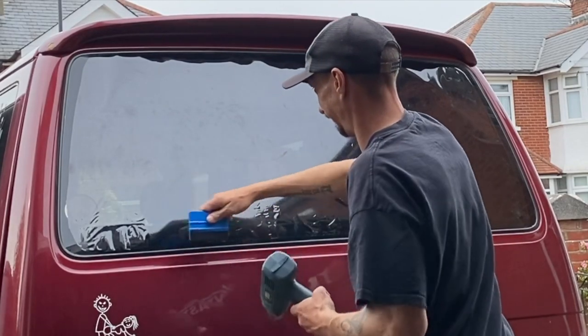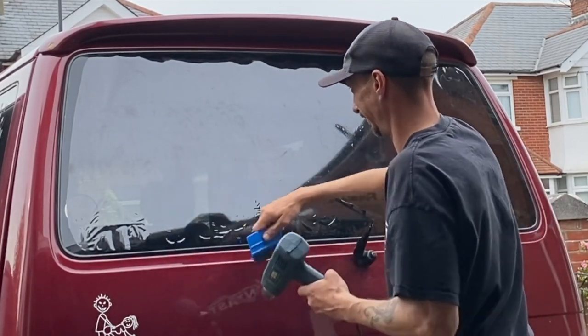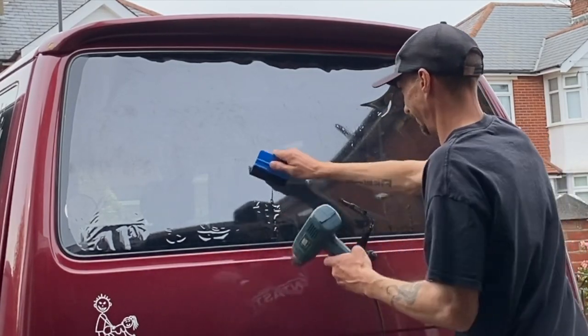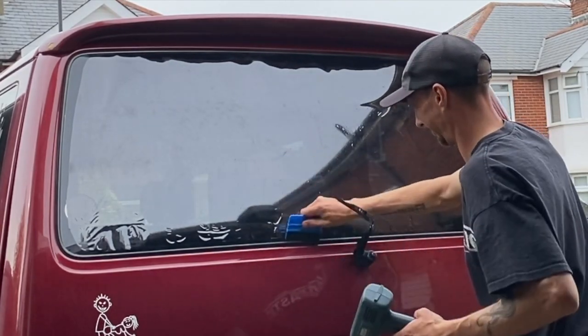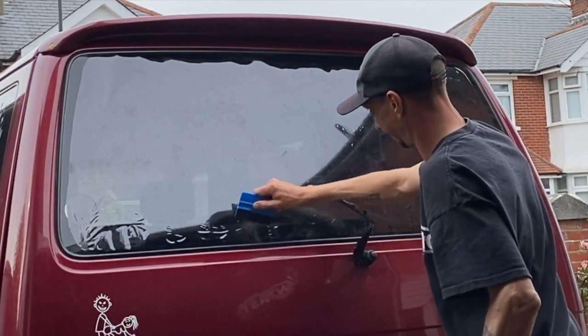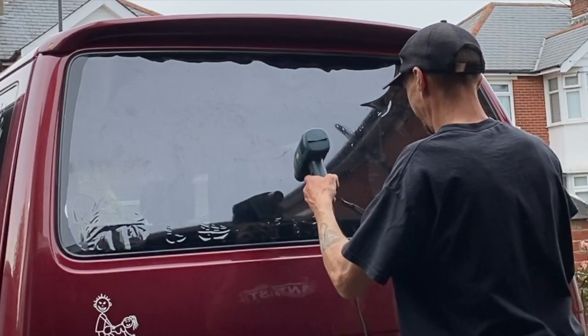And you can see here where the shrink lines are going sideways. That means that it's shrunk enough. That's plenty shrunk. So yeah, I wouldn't really worry too much when it goes sideways like that. You don't need to shrink it anymore. That is plenty.